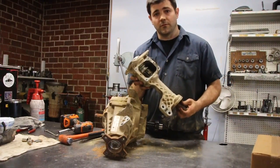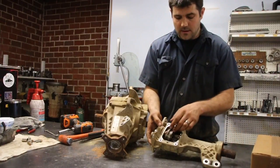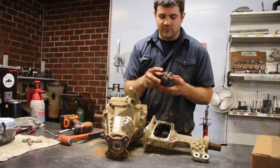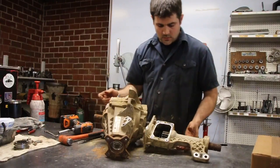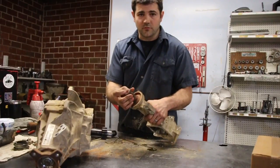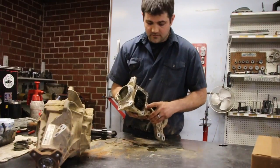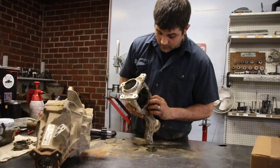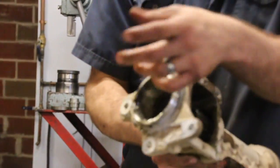This will be the only part that you're removing from the truck. The actuator will be off and then we'll pull the collar off. The collar is the same either way and it's got tapered teeth so you can't put it back in wrong. Once you get it to the bench, this is what you're going to be left with. The splines are quite stripped as well — pretty much the same on all of them. Inside there's a fairly large eyelet snap ring that we'll have to remove before we can pull the shaft out from the inside.